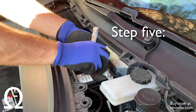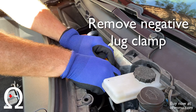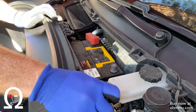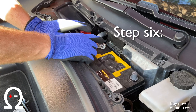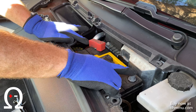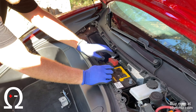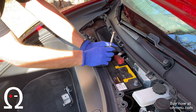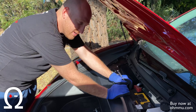On these, I will take the negative lug off — loosen it, wiggle, and lift. Negative, we'll tuck in over here. Really important safety: leave the cap on the positive until you're ready to remove it. Make sure that you've already got the negative side removed before you do the positive. That's important because the positive terminal, if you were to touch it with metal and touch any of the metal structures on the body of the car, you could create an arc and a short.